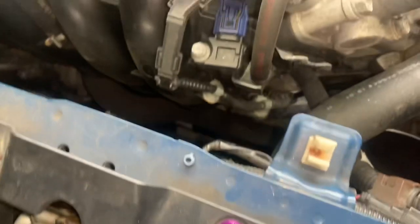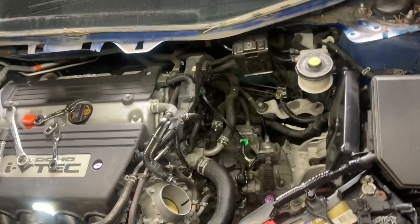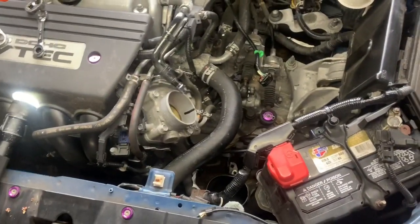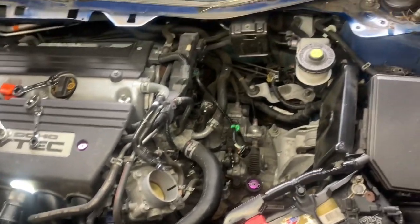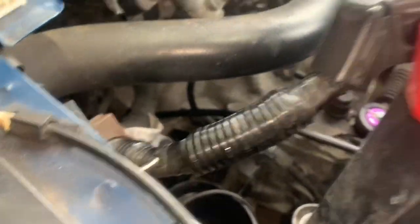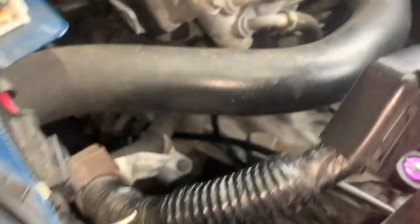It's probably going to be a little pain to get to the bleeder valve, but it's not that big of a deal. Now I've got to go ahead and mount the master cylinder up - attach it on, put the pin through, then the cotter pin, and then start connecting everything back. I've got to put the reservoir back and start gravity bleeding it, and then we're all set. Everything went in fine, everything's good. Right now I am gravity bleeding the clutch - everything's connected. Now we wait.